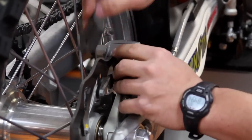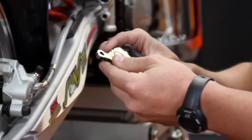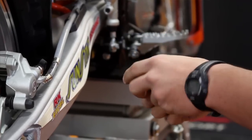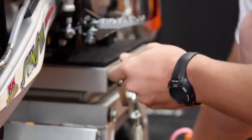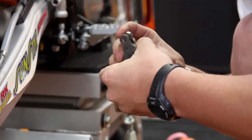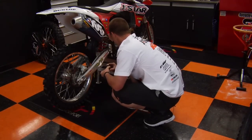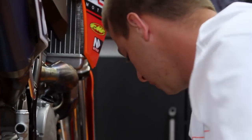Then the pads are now ready to come out. You've got one in the back and one in the front. On the KTM, if you use the stock pads, the right side pad comes with a heat insulator, so you want to make sure you keep an eye on which one is which. After you get the pads out, just look at them — you can see from the back how worn they are. You don't want to let them wear down too much. On Matt's bike, I like to keep pads replaced pretty often. He rides the brakes a good bit, so fresh pads give good stopping power. We're going to replace these — they're pretty bad, pretty glazed over. Set those aside.